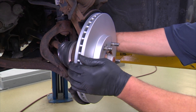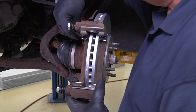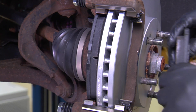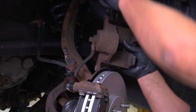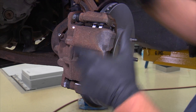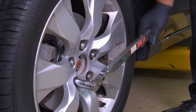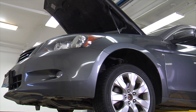It's time to put all of the components back together. Begin by installing the prepared bracket and torque it to specifications. Install the new pads into the bracket — with the prep work completed, the new pad should slide into the bracket very easily. Unhook the caliper from its support and position it over the new pads. Tighten the caliper mounting bolts to specifications, then install the wheel assembly and torque to specifications.